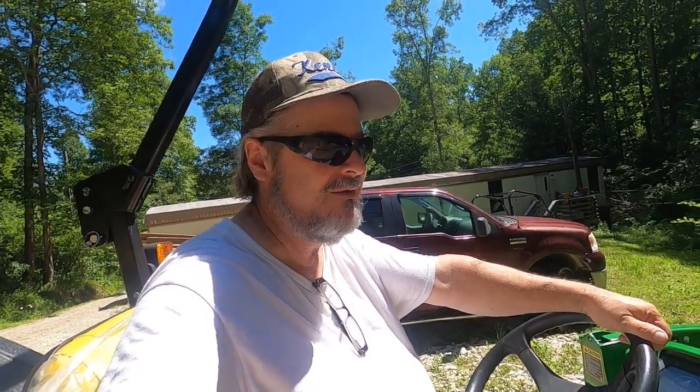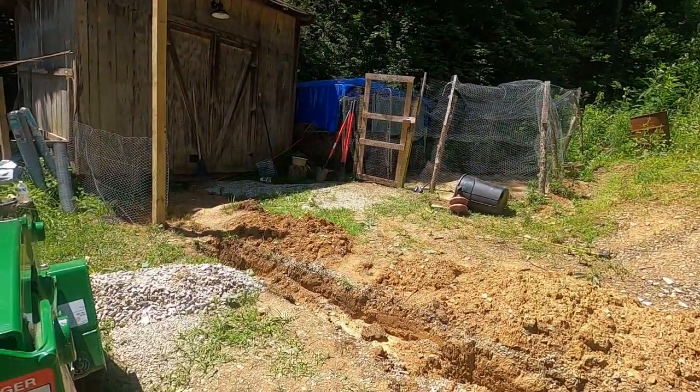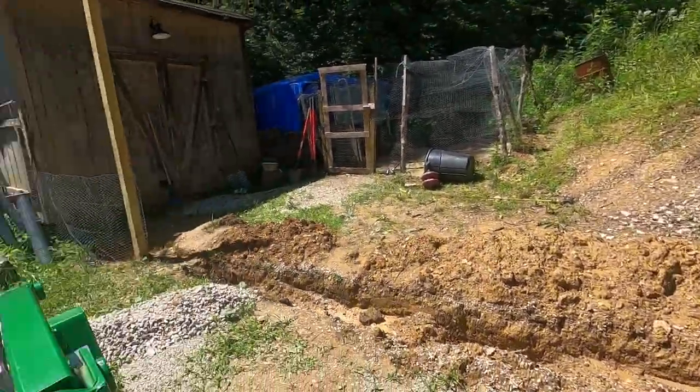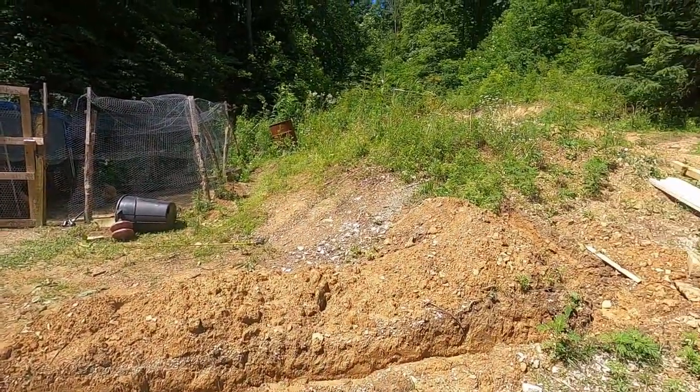But what I'm doing right now is bringing some of the last bit of the dense grade that was kind of mixed in with the ground down there. I don't want to put it on my driveway, so we came up with the idea of using it in the ditch here. Turn the camera around, building a new trench and putting posts in for the chicken coop. So we're gonna mix it and tamp it around each post when we go to put it in. Once that stuff sets up, it's kind of like concrete. So that's where we're at right now. So let's get started.